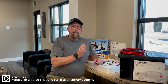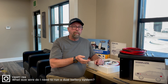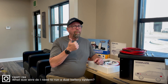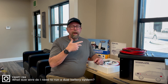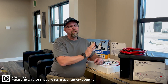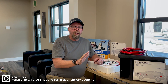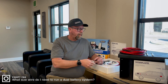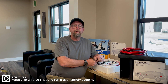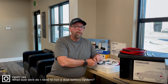Now there might be circumstances unique to your situation where a higher gauge wire is going to be required — some very special circumstances where you're running higher amperage and higher voltage alternators for whatever the circumstances might be in your vehicle. And that's perfectly fine; you can buy the individual components and run your own wire. But what we have found is that in just about every circumstance in an existing vehicle with an OEM alternator system, the 16mm gauge wire will handle the task at hand. That's what I run in my own vehicles, and I've never had a concern about the wire gauge size. So this is what we suggest you run.